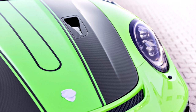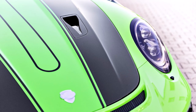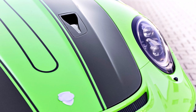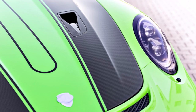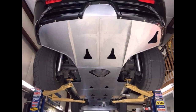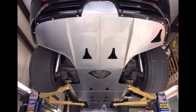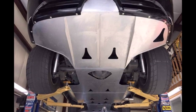If NACA ducts are designed and manufactured accurately, they offer low drag, low disturbance for surrounding flow, and still good air supply. They don't increase frontal area and stay underneath the surface, which is especially good for underbody flow — for example, for rear diff cooling. If you turn the NACA duct around and use it as an outlet, it gently accelerates the flow into the surrounding airstream and creates good suction. But if the sidewalls are not aligned for the job, they can create vortices which can disturb parts downstream.